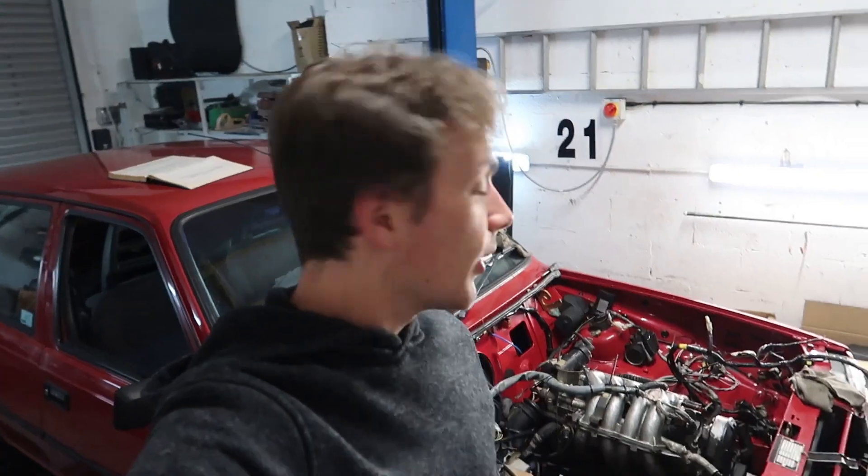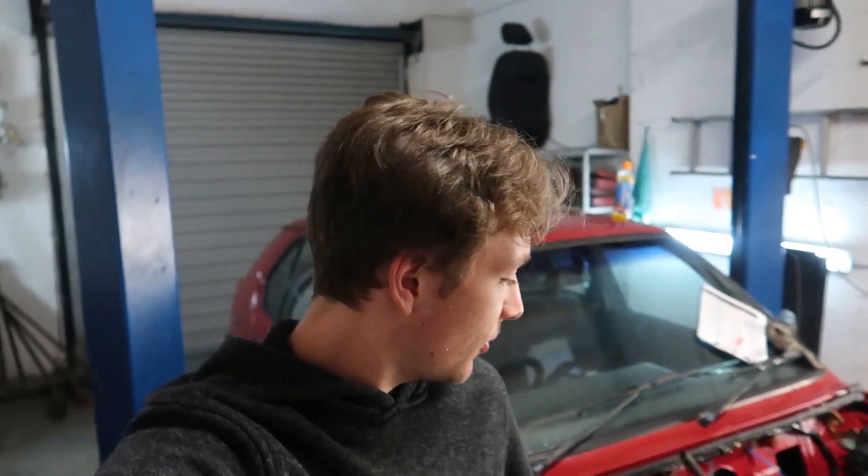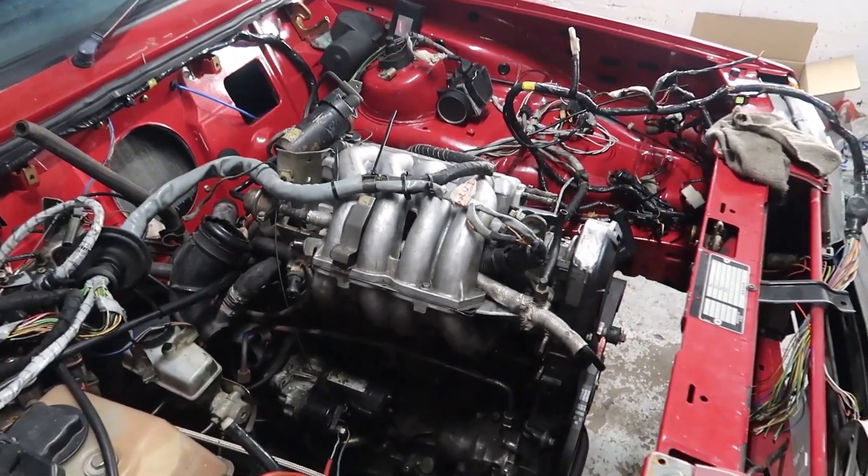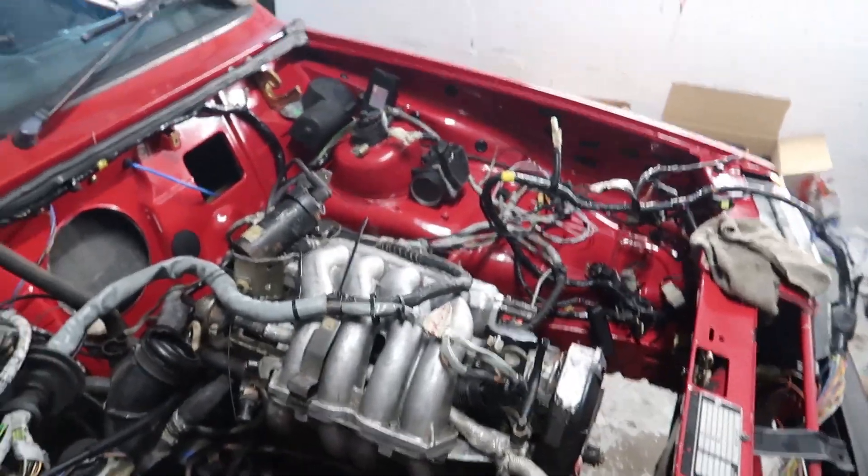The exhaust manifold has been sent off and should be welded up very soon. The engine is now fully sitting in the engine mounts properly located — with the manifold off obviously — and we're just going to secure it, tighten everything down on the rear and front mounts, and might put the propshaft back in. That is where I'm going to end this second part. Next video, part three, which will hopefully be the last part, is all about sorting out electrics, sorting out fuel, getting that exhaust manifold on, and hopefully starting it — hopefully the engine isn't knackered, because I don't even know yet.